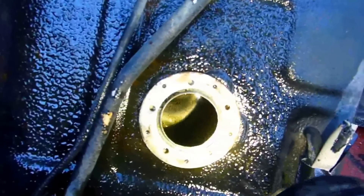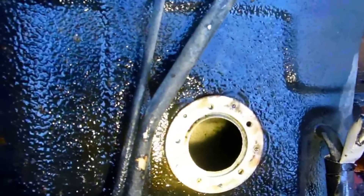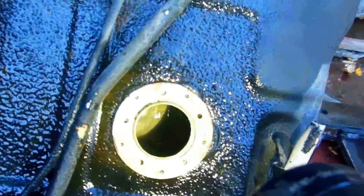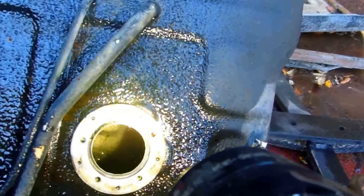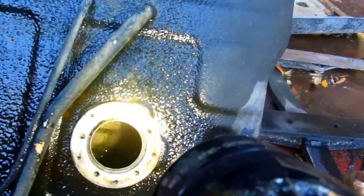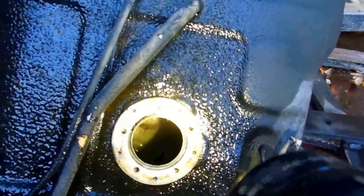Then I'm using Red Coat. Vinegar is some good stuff, man — you don't need any special products. See how clean that is? It's gray. That damn thing was caked with rust, and all this rust just came out even after blasting it a couple of times. Vinegar costs two dollars and thirty-eight cents a gallon. I used just under five bucks worth, and I'll use about seven dollars and forty cents worth total, plus a dollar's worth of baking soda.